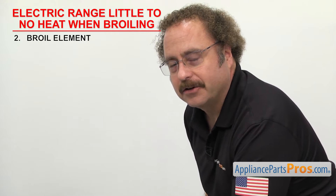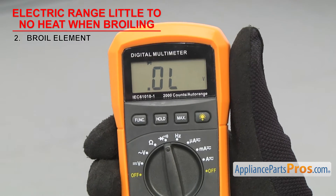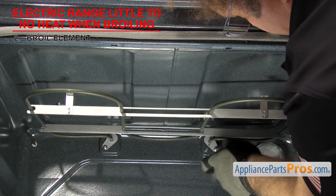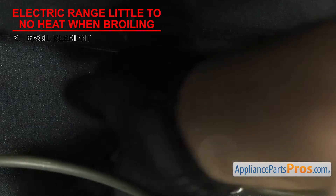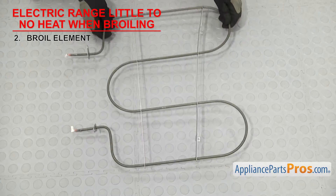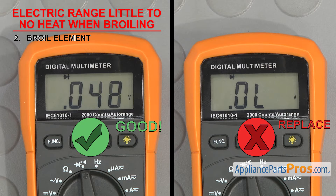In order to see if the part can carry an electric current, we have to test it with a multimeter set to continuity. Once you have it set, touch the probes together to make sure it's working. In most cases, you can remove the mounting screws that hold the element in and pull it forward. Once you have access to the wires, you can remove them, but be careful they don't slip back through the rear hole, otherwise you'll have to retrieve them. Touch a test probe to each terminal of the element. If it doesn't have continuity, then it's bad and will have to be replaced. If you see any swelling or damage, you should replace the element even if it has continuity.